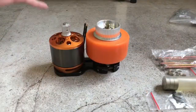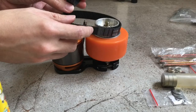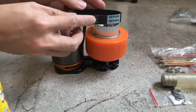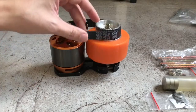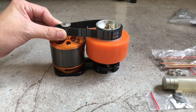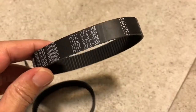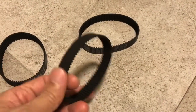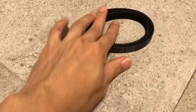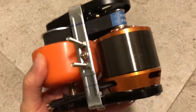I have the electric motor sitting here to drive the wheel via the pulley system, but I realize I have a problem. The belt I should have ordered is too long — 273mm is too long. And the one that comes with the kit, 225mm, is way too short. So what I'm going to do is cut this belt and get the exact length which I require, and I will have to order a new belt. After 2 weeks of waiting the belt has arrived — this is 252mm. The long one is 273mm which I had ordered previously but it was too long, and the shortest one is the one that came with the electric skateboard conversion kit. The 252mm one in the middle is the one that I need. Here's the belt installed and it fits nicely.